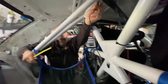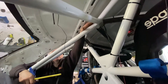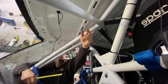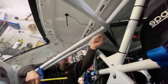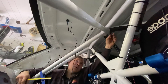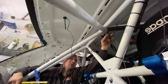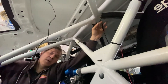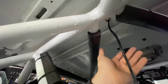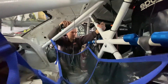We are going to have to route the cable. It has to come under the cage. You cannot route the cable between the cage and the roof so that they don't get pinched. So we'll be routing that under the cage here and all the way to the co-driver over there. Those are the wires of the main antenna. We applied some sealant around the nuts and the wires just in case there is a slight leak from the roof, so hopefully it would stop there and not get into the car.